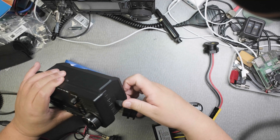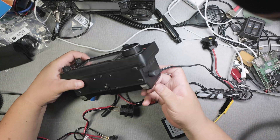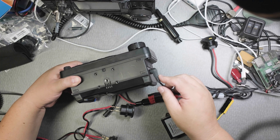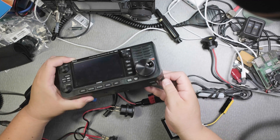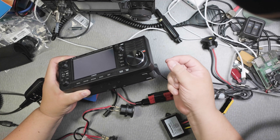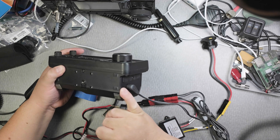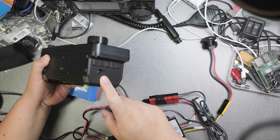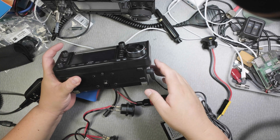If I plug it in here, you can see it's charging. The great thing about this plug — I do have a YouTube video on it — there are different types of plugs you can get, but I definitely like this angled one because when you put it in the box, it's flush. If it was straight, it might jiggle the port a bit. These ports might be a little delicate, so best practice is to have an elbow connection like that.